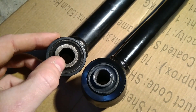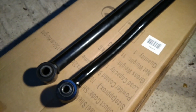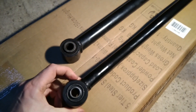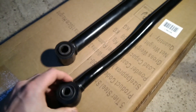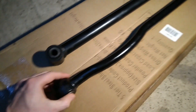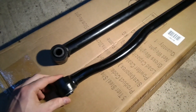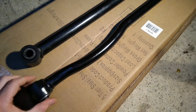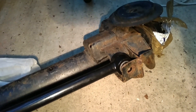Presumably that's a bit of a stiffer ride. This one is forged so it's solid metal and it's really damn heavy — if you drop this on a paving slab you'd probably smash it. Whereas this one is made from tubular steel so it's actually quite light, which is surprising. This pre-2002 one is also the same part for left and right-hand drive vehicles. It's got this crank bit in it which, on left-hand drive vehicles, allows it to clear the diff because the pivot point is on the axle. And on a right-hand drive it fixes at this end and there's lots of clearance for it to pivot up and down.